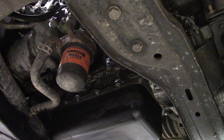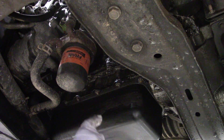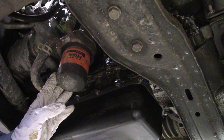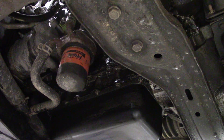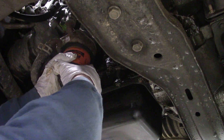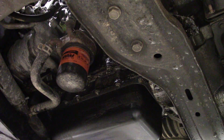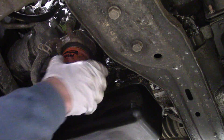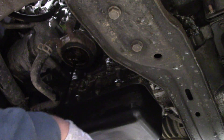The other thing you need to remember when changing your oil is to change the filter. The filter is towards the front of the car from the oil pan. A lot of people crank them down, but I don't even use an oil filter wrench — I just use my hand strength. Before it starts leaking oil out I'm going to raise up my drain pan, get it right up into place, then spin the filter off quickly and drop it right into the pan.